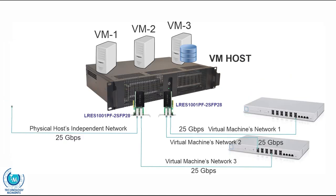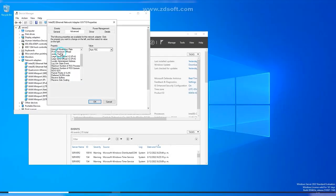Let's explore some important considerations to keep in mind when using these cards. Most of the configurable options of this network card can be found in Device Manager under the Advanced Settings, which will provide you with all the features you can adjust in order for the card to connect or work successfully in a particular environment. For instance, if one of your ports is going to connect to a 10 gigabit per second switch, you'll want to set the speed to the desired value.